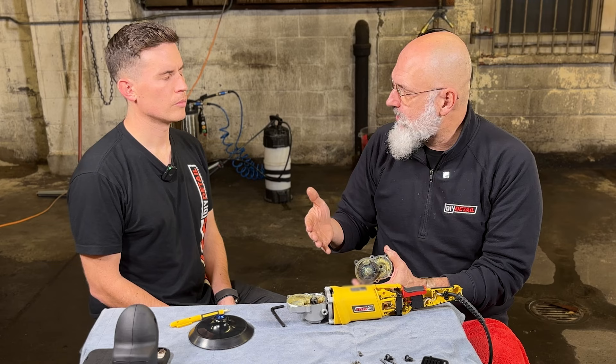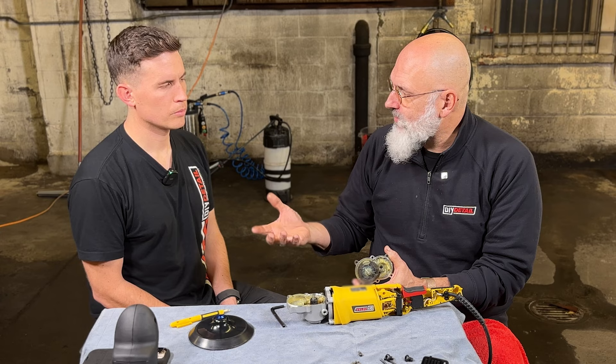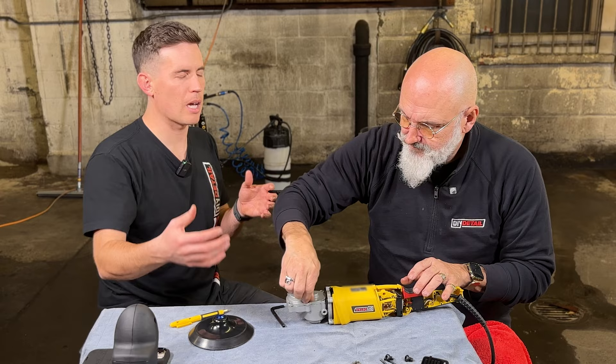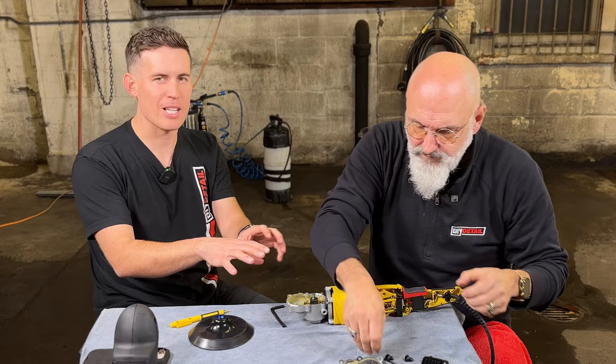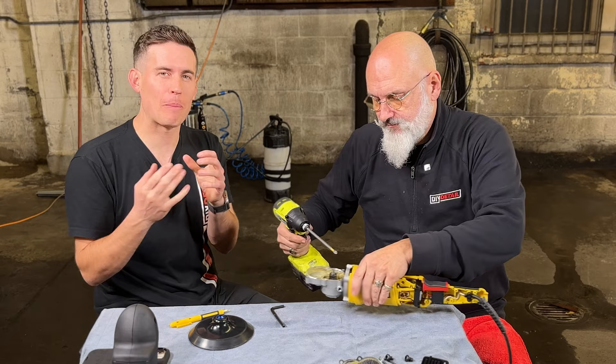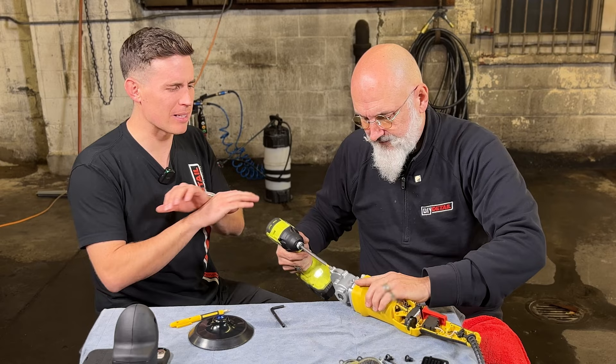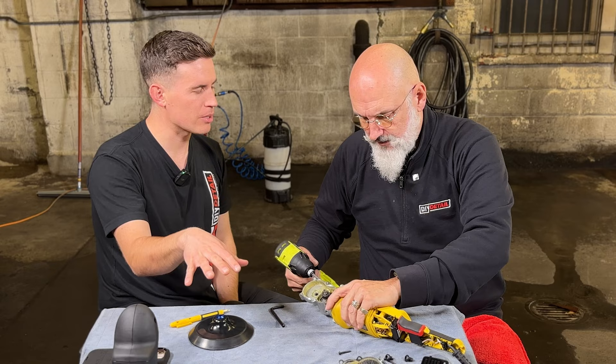The 2500 RPM high end is to clean our pads and spin out excess moisture. With some tools we've used over the years, when spinning out our red rotary jeweling pad, the machine wasn't fast enough to dry the pad. So we have both: the higher speed we want for pad cleaning and the lower speed we need for cutting. At DIY Detail we teach a polishing system — cut with a dual action polisher, finish with a rotary. The only time you use high speed with the rotary is to spin out the pad after cleaning it. You polish with a lightly damp pad on speed one, then free spin at high speed in the pad washer.